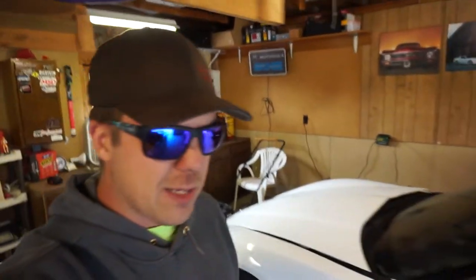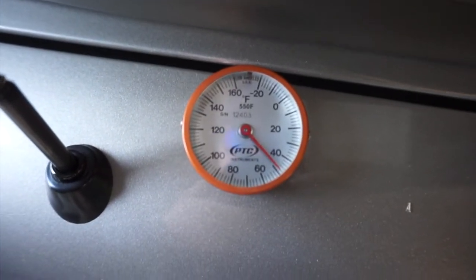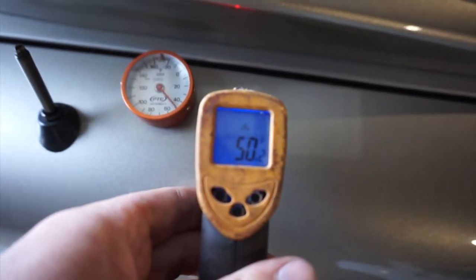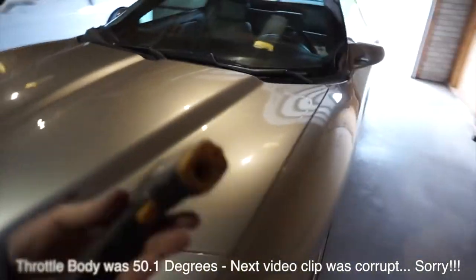We're going to do a kind of dirtbag scientific study on this. Right now in northern Minnesota we have our calibrated temperature probe here showing just below 50 degrees — like 49; my truck said 45 on the way home. The method we're going to use to measure the throttle body before and after a long drive is this little thermal heat gun. It's a couple degrees off, as you'll probably see — we got right at 50. We'll measure the throttle body case temperature and see if that 10–15 bucks even does anything.